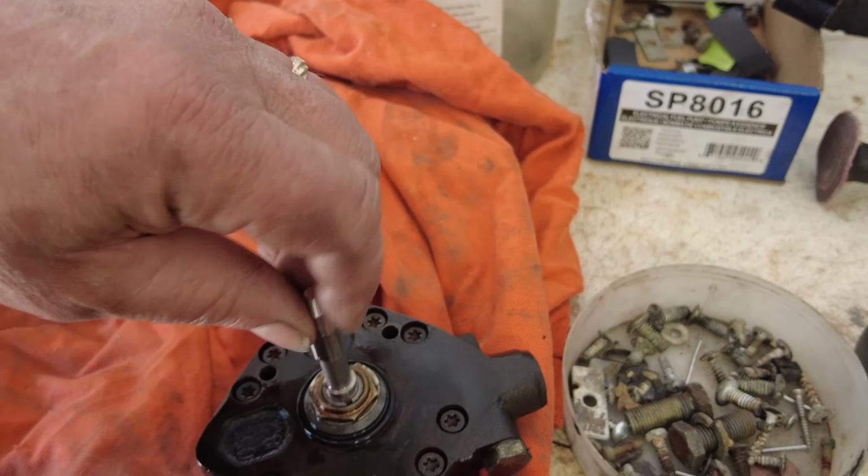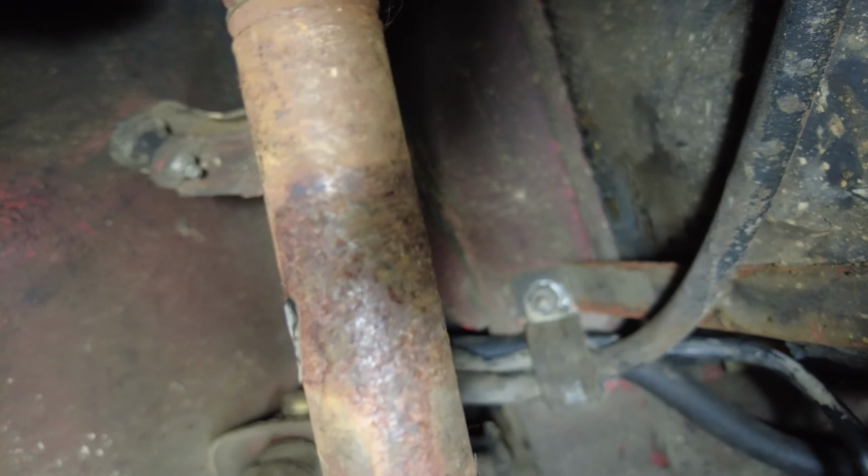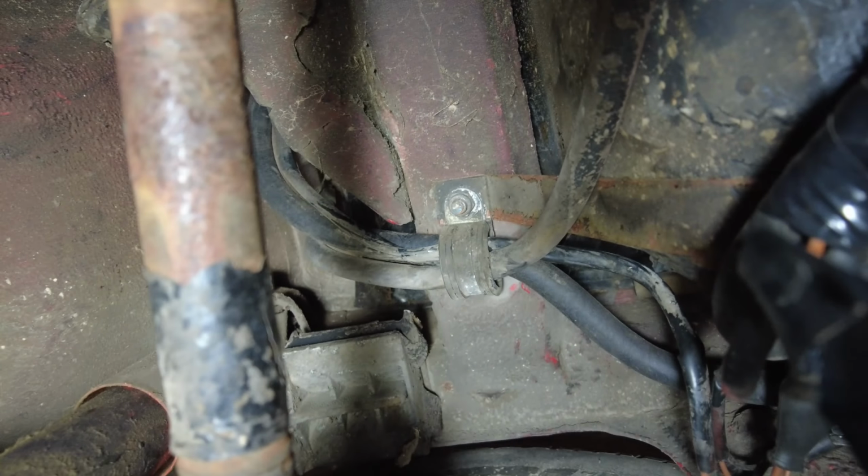So that hose got to be taken out of there. And I've got most of the old hose. The only thing that was really plugged was the check valve. So the hoses seem to be good. Just the check valve was bad. So I'll put the hoses back on. I may order new ones eventually, but for now I'll just put the hoses back on and see if I can get the thing to run.